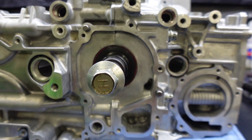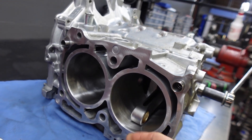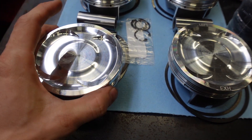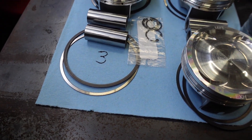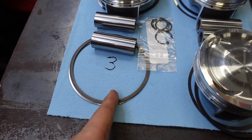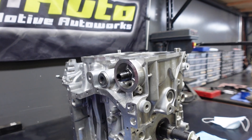Just like that I got the case halves together and it is looking good. Got it bolted up, greased up the crank, and it spins pretty freely. Now I just got to drop in the pistons. I have my pistons all labeled. Still got to do some things to the cylinder heads — I want to do a light pocket port — but for now let's drop in these pistons.